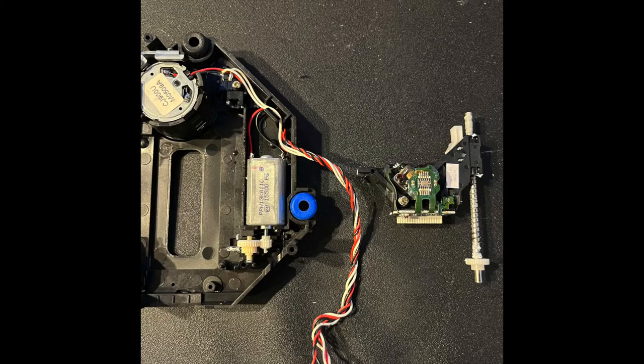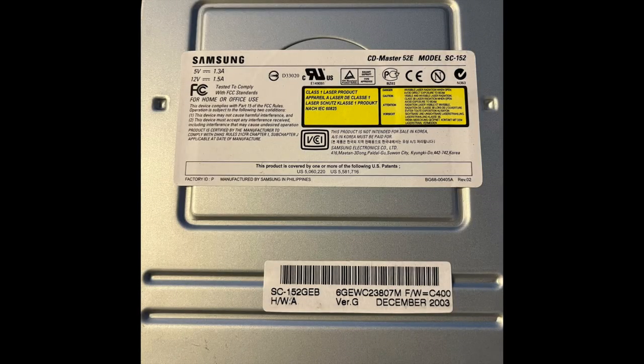Once you've removed the laser and the rail, you can twist the rail counterclockwise and fully remove it from the laser. Now it's time to talk about where you're getting your new laser. It can actually be from any CD-ROM drive — the best ones are from the early 2000s, around 2000 to 2003. You can find them on eBay or at some thrift stores. It has to be an actual CD-ROM only — not a CD-RW, DVD-ROM, or Blu-ray drive, as those don't work. The reason is that the ribbon cable connection from your Dreamcast is pinned out in a way that matches old original CD-ROM lasers — DVD drives have different pins and won't work. I'll put a list of known working drives in the description below.